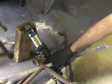The lower wishbone arm has a large bushing and a smaller bushing — two different types of bushings, which are actually in two parts, but we'll discuss that later. This one is fitted to the chassis underneath. It's fitted there with this bolt. The good thing about this bolt is there's a nut welded at the back, so you only need to undo it from here — I think it's 19 or 17 mil — and it will come out. You don't need to hold anything behind it at all.